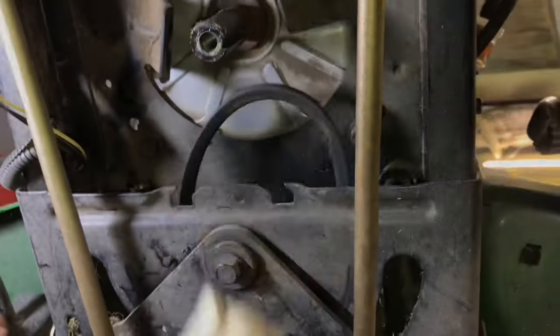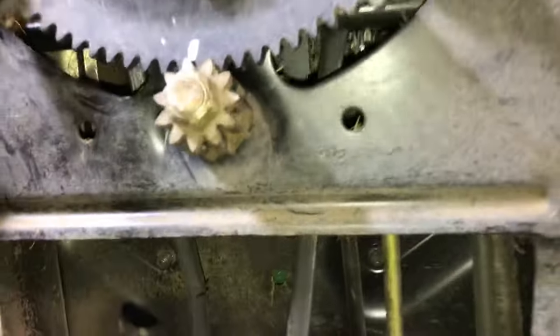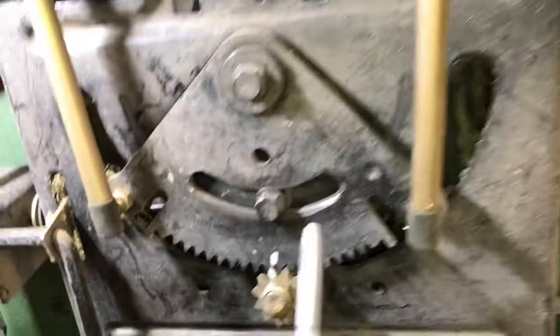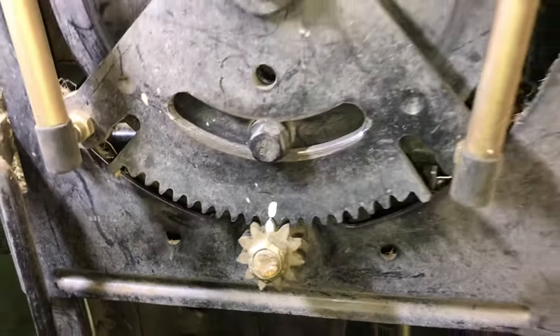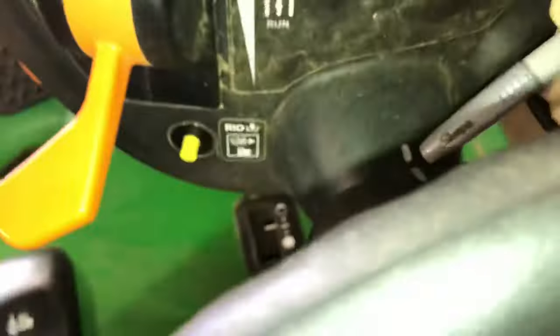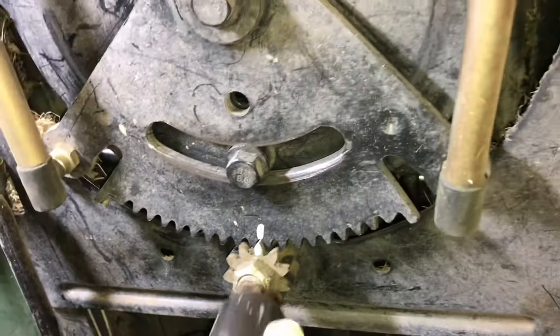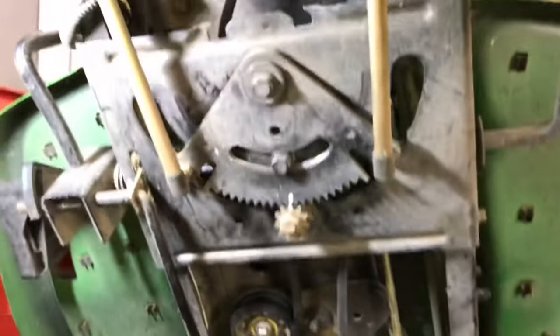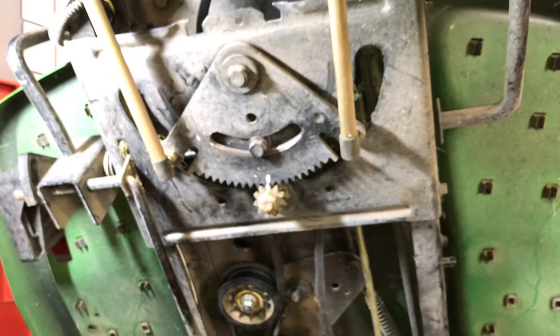With the belt loose, you've got to come down to your steering. This belt is between the steering shaft. I already put on the silver marks — I used a silver marker, got the steering straight, and marked right where it comes out so you remember where to go. I also marked the steering wheel with two little marks so I know when I put it back together again that it's going to be straight. That socket is going to be a 19 millimeter or a three-quarter inch — I'm going to use a three-quarter inch impact. Someone's going to have to hold the steering wheel if you're using a half-inch ratchet.